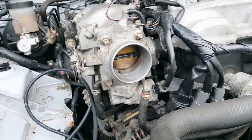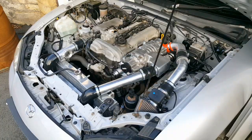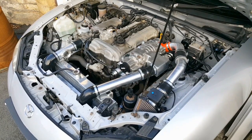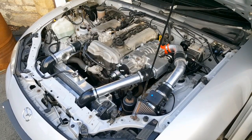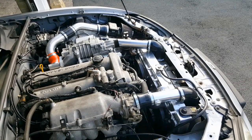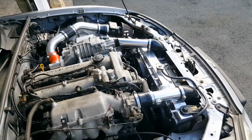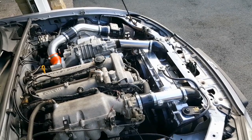When the throttle plate snaps shut, all that pressure has to go somewhere, and rather than have it trying to back up into the rotors of the supercharger, it'll vent out of this blow-off valve instead. It's pretty simple how it works — it's just vacuum operated, so when the intake manifold is in vacuum the valve will open and you'll get that classic sound that people seem to like so much. I'm not sure I get it, but there you go.